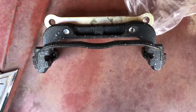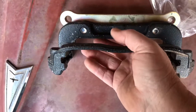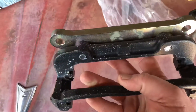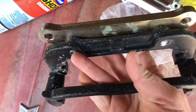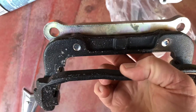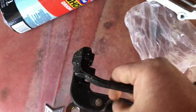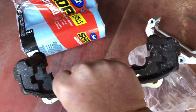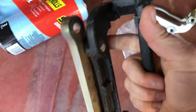Originally I was going to run C5 Corvette brakes on the Formula's modified spindles, so that's what this bracket here is for. This would modify your factory F-body spindle and allow it to bolt the C5 or C6 standard caliper abutments on.